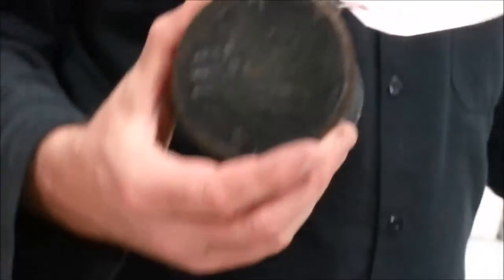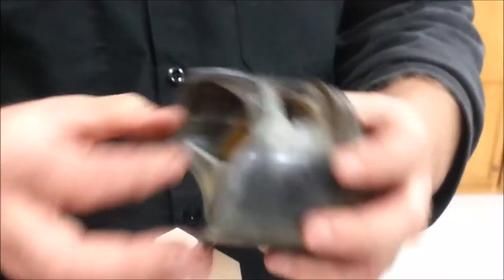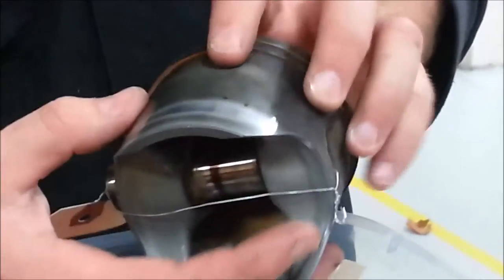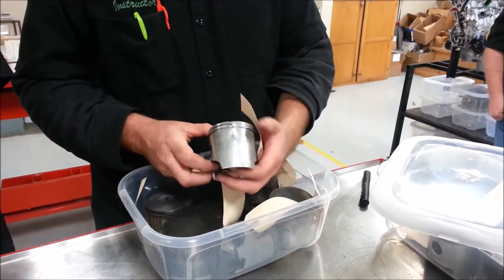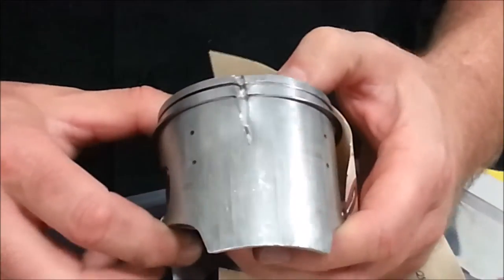I wonder what this is out of — it's got the steel pin in it still, but that's a big, heavy piston. You see how much blow-by we had here? We had a lot of blow-by on this one. And you see where it even got a shiny spot on it being rubbed off? What happened here? I'd say it got something down inside there — a big piece of something.